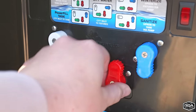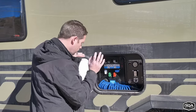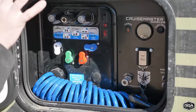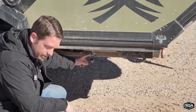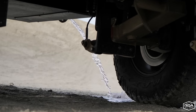When you pick up your trailer from ROA, we do a thorough walkthrough and teach you all of this. We also have a video library that teaches you how to operate and manage everything. The water inlet is pressurized with a pump, and there's another button for the macerator — your gray tank drain system. The drain valve is like a standard garden hose spigot; you turn the valve, turn on the pump, and it's pressurized. The macerator chops up anything — like hair from the shower — like a blender.